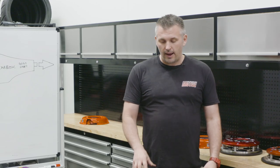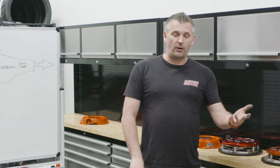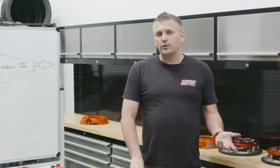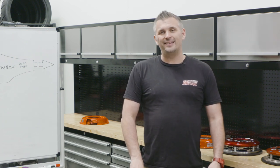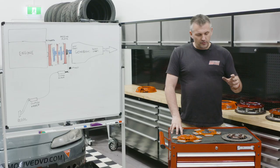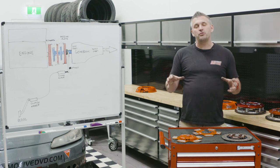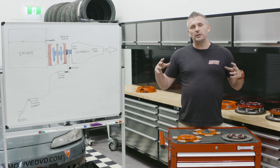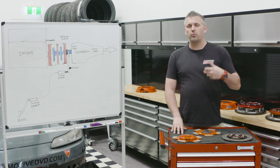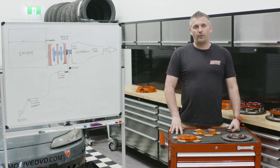Another factor to consider is that a twin plate can be rebuilt. So even though they cost a little bit more to begin with — approximately $2,000 — you can rebuild them for anywhere between $500 and $800. So over the life of the clutch, it actually works out a little bit better on a twin plate some of the time, just due to the fact that it's easy to rebuild. Next time you want to choose a clutch for your car, start factoring some of these considerations. At least now you know the theory, so when you do talk to a clutch manufacturer or your mechanic, you know a little bit more about what questions to ask and can understand why they're telling you to get a certain type of clutch for your car — which makes it easier to understand and a better purchasing decision.